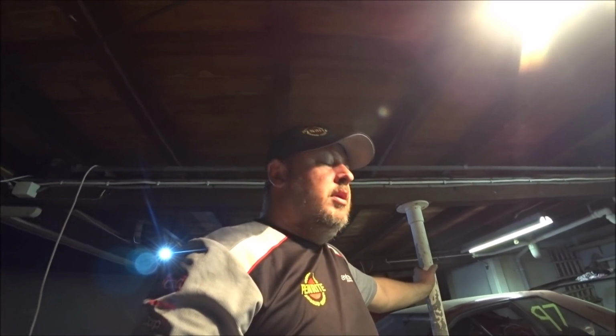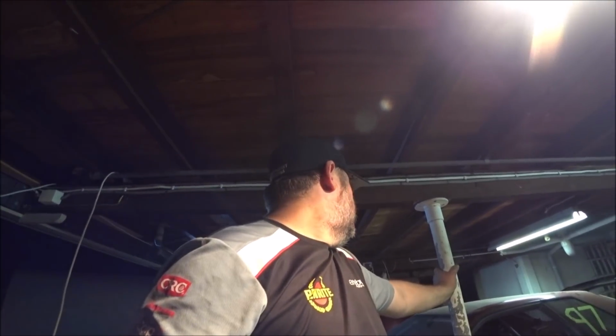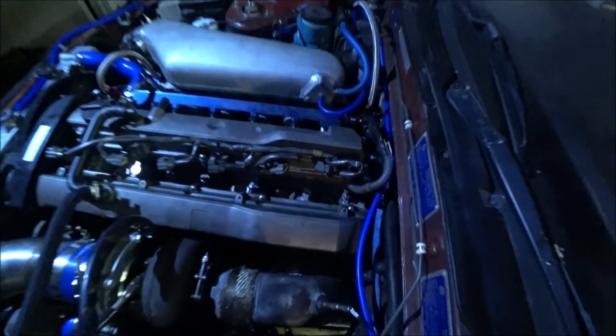That's it. I told a lie a second ago. I said I'd have the fuel pump relay out. I don't. I've unplugged the injector loom. The reason being, there will probably be something in the ignition circuit which will do something stupid. So, fuel pump relay's in. Injector loom is unplugged. Spark plugs are out. This is so it's got zero resistance and it should free spin and make the oil pressure real quick and easy. So we're not starving it of oil up the top. So very close.